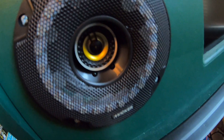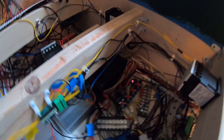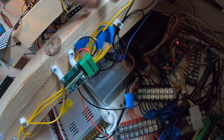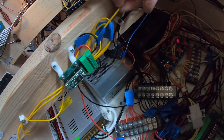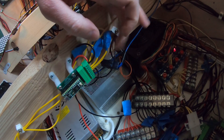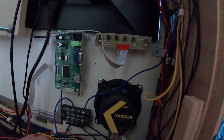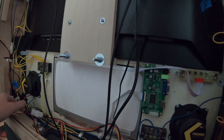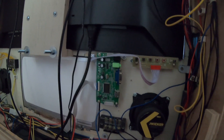So the PAL board — the Teensy-based board — you've got your five volts, your ground, and then you can use one or all of these outputs. This is for the right strip, the left strip, the backboard, and the rings. So the input comes in through here, goes to the output, and goes over to the next one. I made these fancy connectors — soldering them probably would have taken half the time anyway. So if we take this we can do a test.